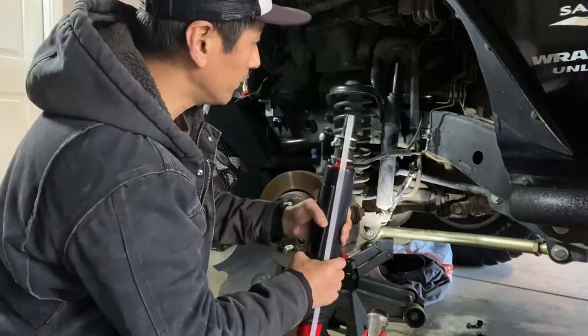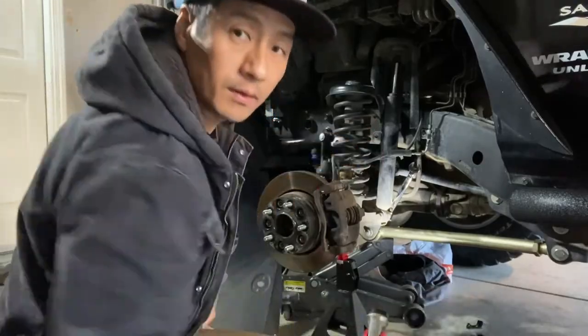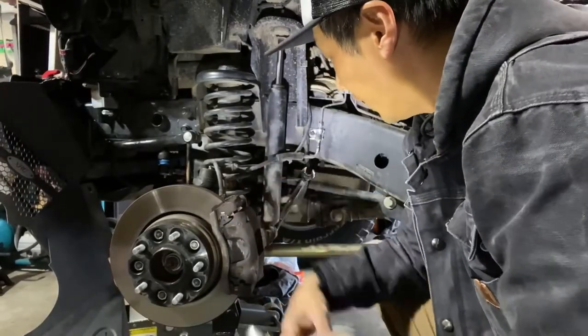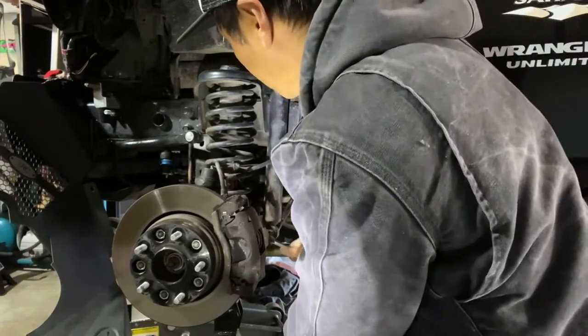In my case the new shock is about an inch and a half shorter than the current setup, which is great. That means I can keep everything as-is, mount the shock, put the new one in, and then slide the bolt through the lower bracket. There's a little trick to that — we'll get to it. For now let's go ahead and take the old shock off. I've got my 18-millimeter wrench and socket and I'm going to knock out the bottom bolt first.